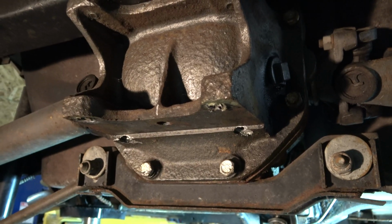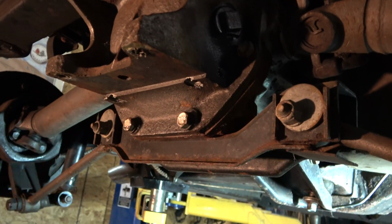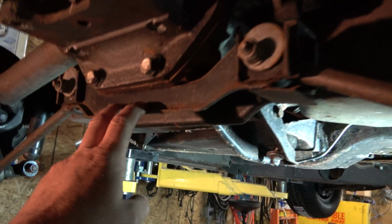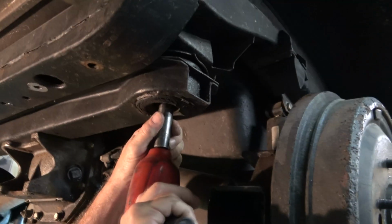If you want a bolt that wouldn't go tight, you have to have the perfect length bolt there. Might have been easier in this casting had we had tension on this when we released them, 4 bolts. Something to think about. I'm gonna find something to support this, and I think I'll zip off these 2 to see how far it drops down. Here there's 4 bolts coming down from the top into it. Here's our setup, tranny jack under the diff.